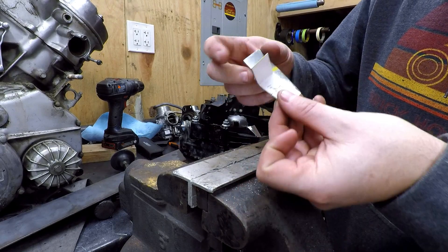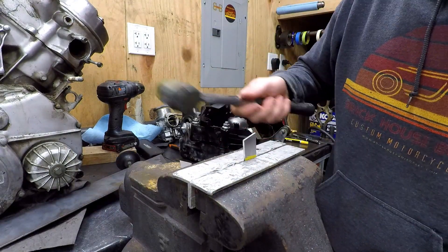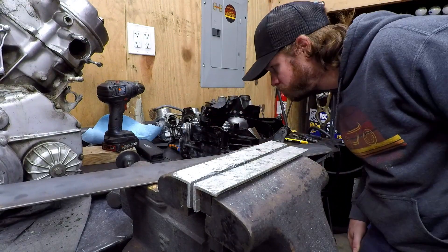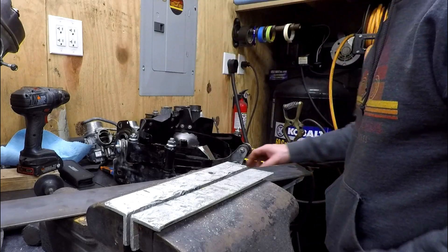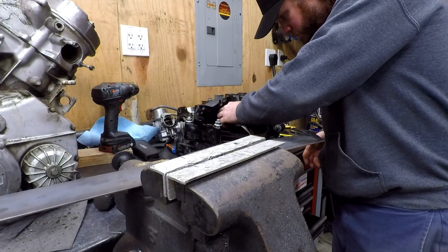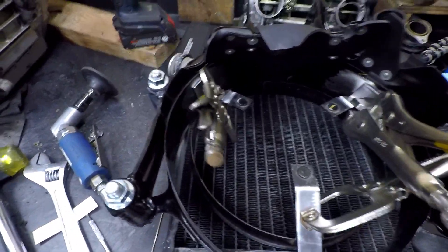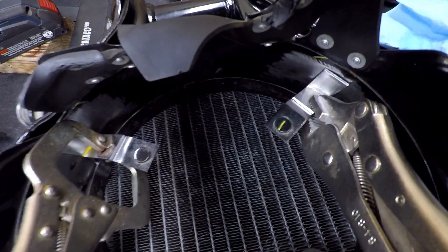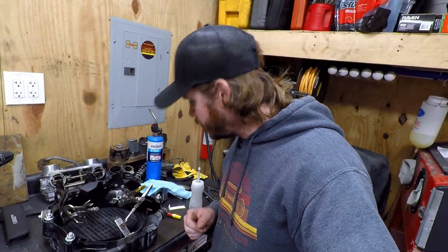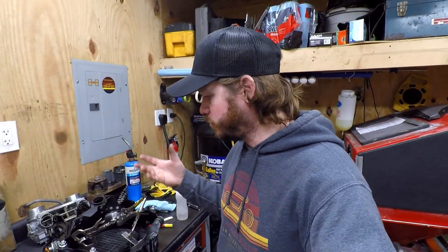This one's going to be bent at a slightly weird angle since we're offsetting the circle here. This looks like fun, doesn't it? Just getting everything clamped in place. I'll start with tacking and welding where I can, then pull the whole assembly apart and weld it off the radiator so we don't put too much heat in where we don't want it.